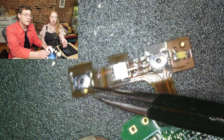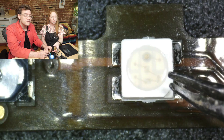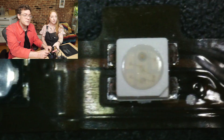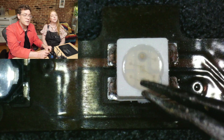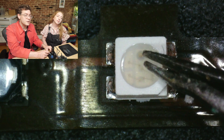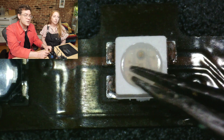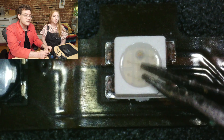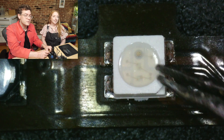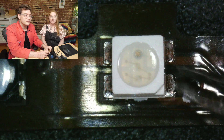Let's zoom in on the RGB LED in the middle. An RGB LED actually has three actual LEDs inside of it, inside a package called a lead frame. These little squares here, here, and here are the actual LEDs — the actual diodes, little pieces of silicon that make the different colors. The rest of it is wire bonds that lead out to the connections, so those are the actual diodes that make the light. The rest is just stuff to hold it, plus the plastic to keep it from breaking and also diffuse it somewhat since there are three different LEDs in there.